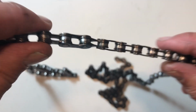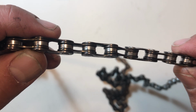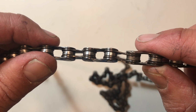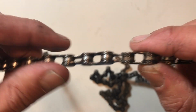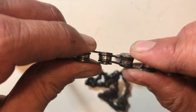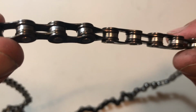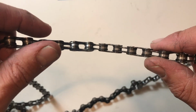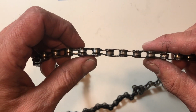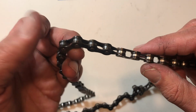Typically, the telltale sign when you have this type of situation is that as you're pedaling, you might get 2.5 pedal revolutions or so, and then you might get a skip. Your cranks may slip a little bit over the chain ring or the cassette sprockets, or just going through the derailleur. Sometimes that can be an issue of one of the chain pins starting to come out. If you're out riding and that starts happening, I would recommend getting off your bike, turning your crank backwards, and watching the pulleys at your rear derailleur to see where it skips. That'll isolate the point of the problem.